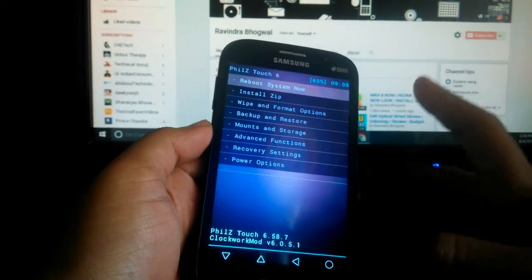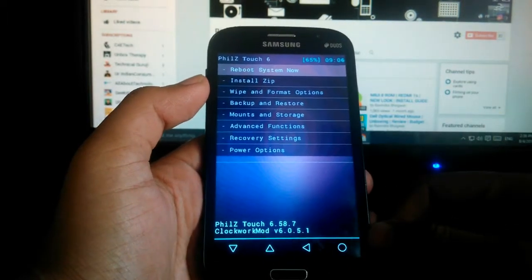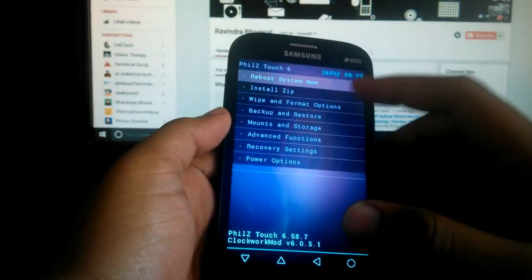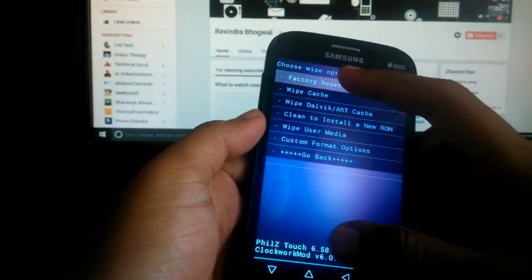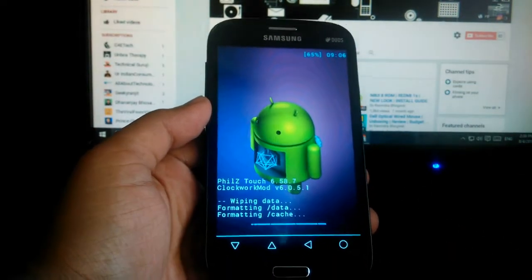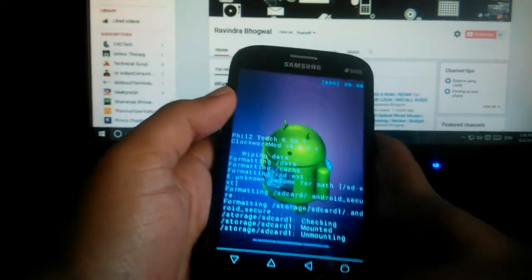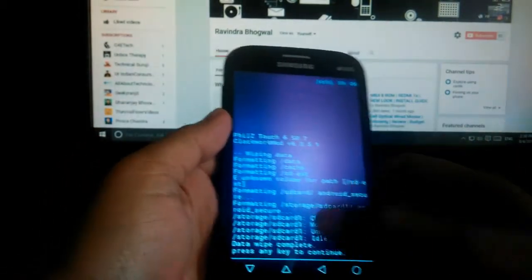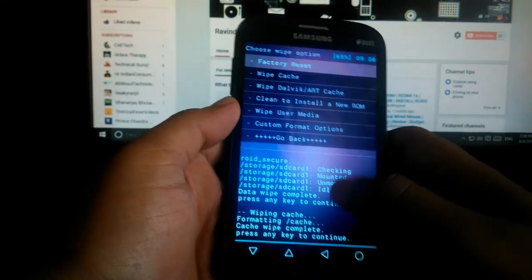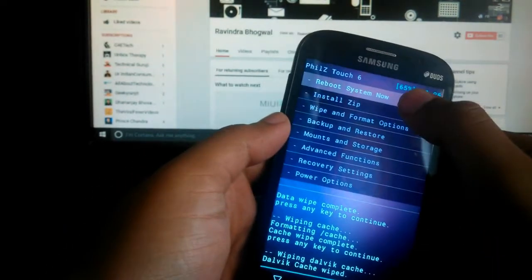You have to download two zip files: one is the CM13 file and one is Google Apps. That link will also be in the description. First wipe the data. After wiping the data, you have to wipe cache and Dalvik cache. It is the same method in any recovery. And just hit install.